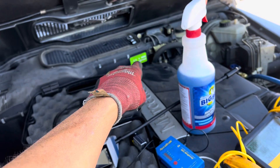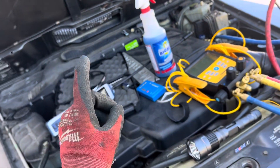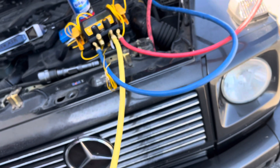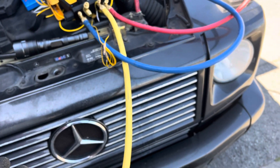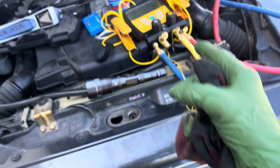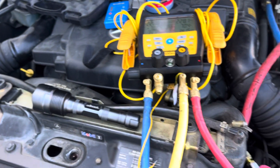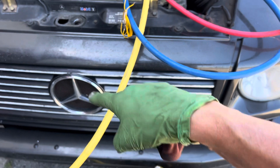This is why you put in UV dye - because those difficult leaks, sometimes a day, week, month, or year later, the situation will come up where it starts leaking and leaves evidence like this, even though everything was clean and dry before. Especially with PAG and POE oil - they're water-soluble, so if the car came in after rain or was thoroughly cleaned, you can literally wash off the oil during a car wash and there'll be no evidence. Do not rely on oil stains to confirm leaks. In this case, when it was here last year these areas were dry, but I put in my dye - and now I find it, and there's an oil stain. On this one it was so new you couldn't see it with your eye; you had to have the UV light.